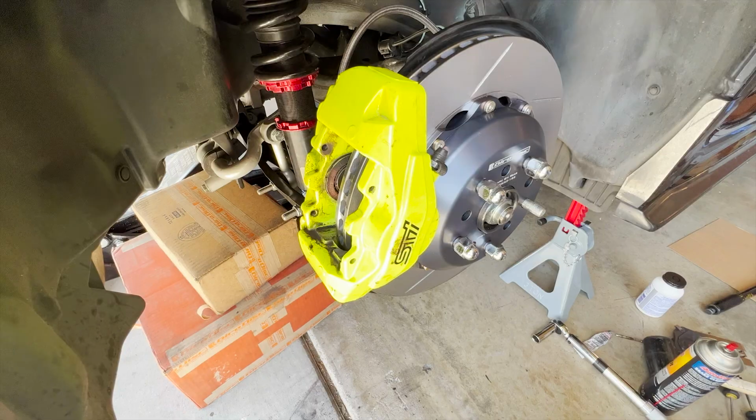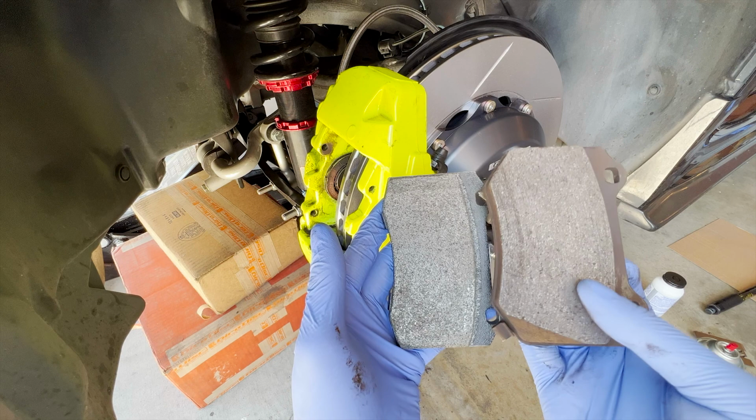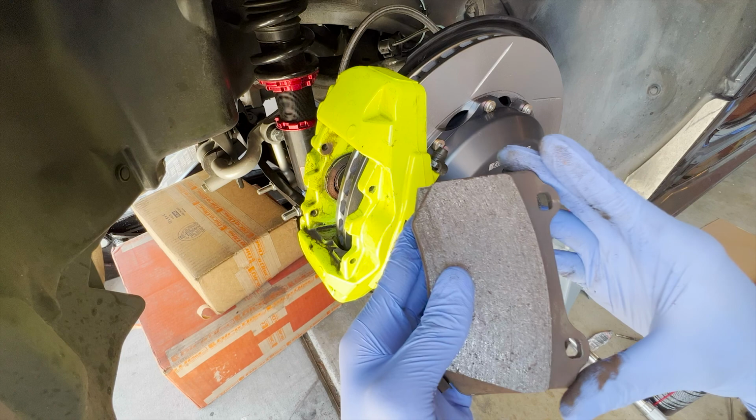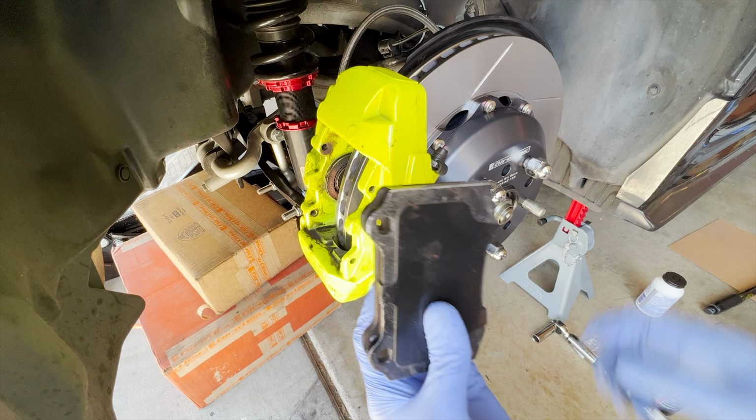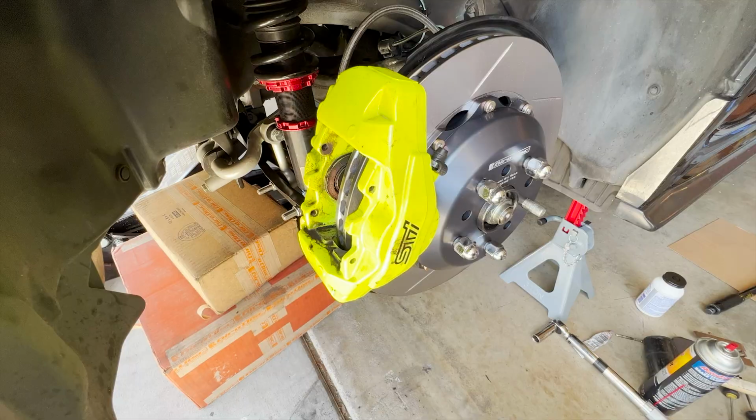And before we do the rear pads, I just want to show you a comparison between the stock one and the GiroDisc one. The GiroDisc are here. You can see that the material is a bit more on the stock one compared to the GiroDisc. See right there. If you line up the holes, there's just a bit more meat on the stock ones, but that has to do with clearing the two-piece rotor here, which is fine, but you lose a little bit of pad material.